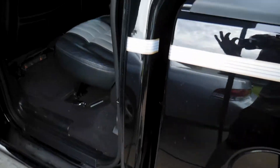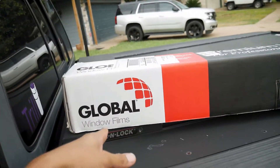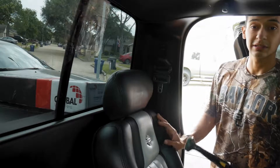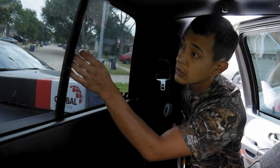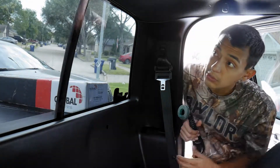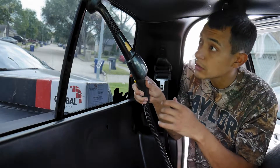Here's a look at the old film. The film I'm going to be using is Global Window Films — using their ceramic. The steamer is nice and hot. I fold the seat down to get full access to this rear window. This film is actually already starting to peel, so I'm just going to heat it up so it doesn't leave too much glue residue and get working on it. It should be pretty easy.